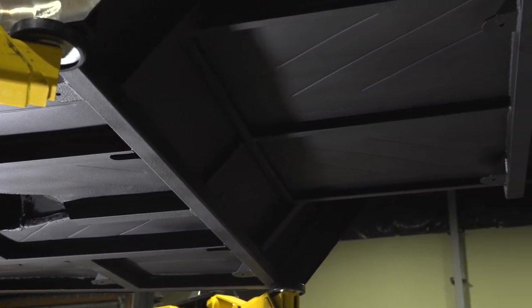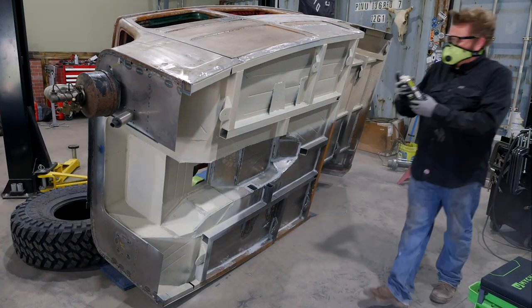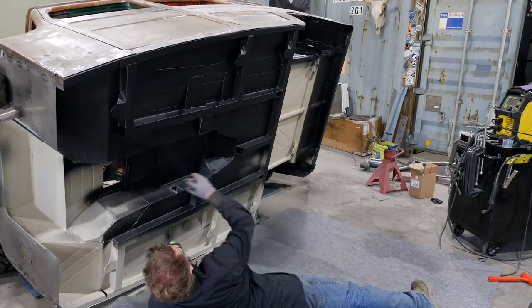The process was time-consuming. I had to seam seal every single joint between any of the structural steel or original Willys Wagon and the new sheet metal with SEM seam sealer, then spray it with epoxy primer. But before that, I had to prep all the panels — wiped them down with a vinegar and water solution to etch them. A body guy explained it to me like this: epoxy primer is like glue — it sticks to anything, and then anything you spray after that will stick to the epoxy primer. Laying down a good coat of that gave the Raptor liner something to bite into. If I just sprayed it over bare metal, it would basically flake right off. By doing the proper steps, I know this is going to last the lifetime of this rig. I did completely ruin one of my shirts — got seam sealer all over it — but that's okay. That's why they're called work shirts and not going-out-to-dinner shirts, even though I often wear them going out.